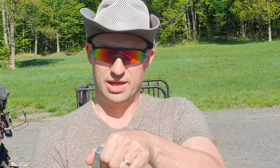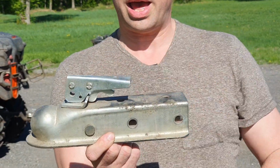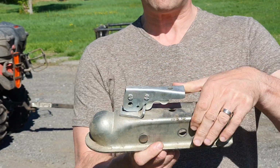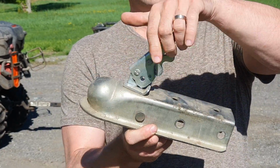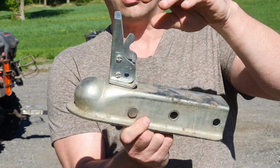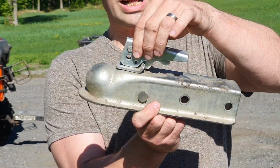So I'll show you on this hitch here. So you do have a latch on the bottom, and that does go in and clip in. But if you get a bouncy enough road, what can end up happening is things can trigger, and that can actually release, and now that is no longer holding the ball. So your safety tip, make sure when you're going around, you check that.